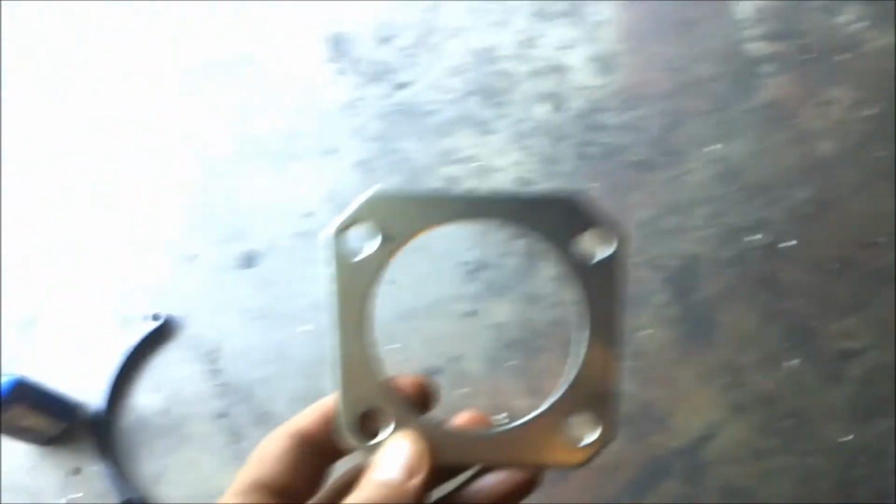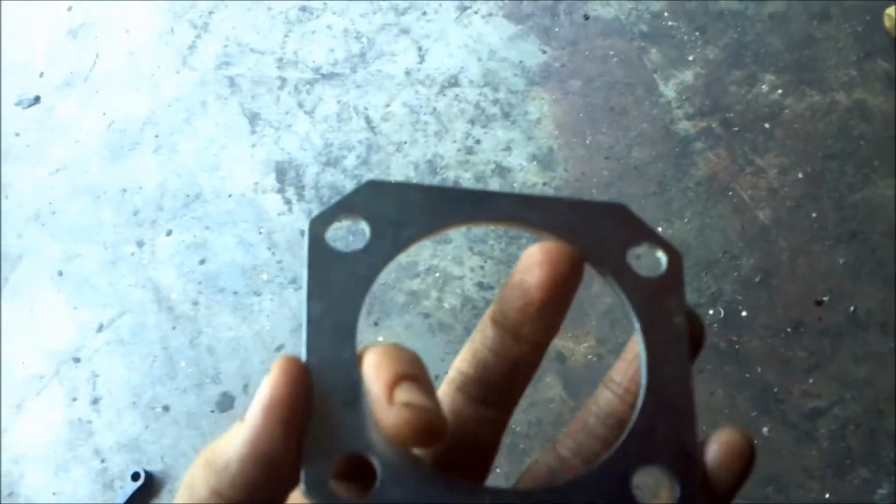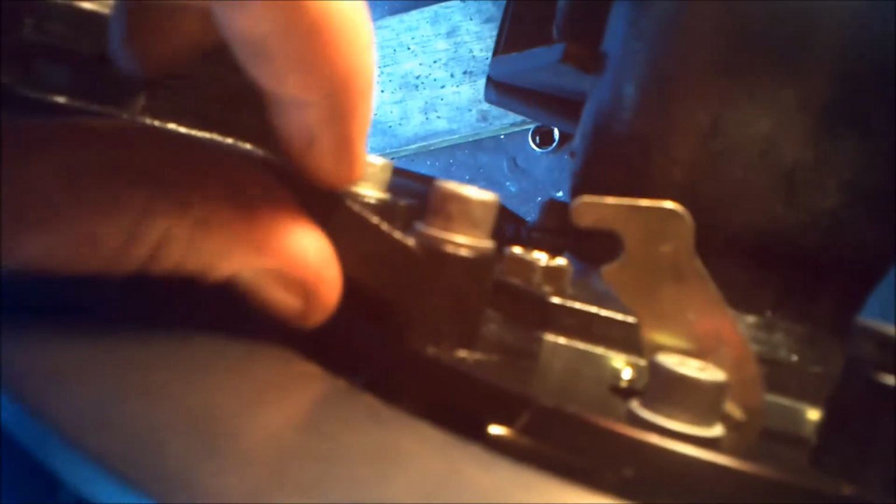Well, then I have these nice 12-bolt rear end shims, and this shim can go between the axle flange and the backing plate. And if you see right here, you can barely see the silver steel shim in between the backing plate and the axle flange. So this pushes the backing plate forward about 1/16 of an inch, and then removing that half moon shim moves the caliper mounting bracket backwards, and we now have a caliper that is centered on the rotor.